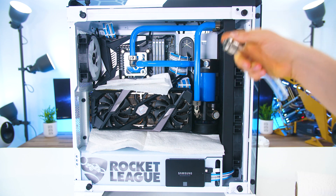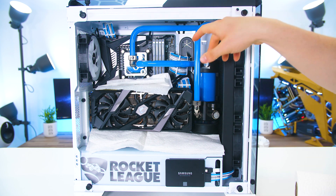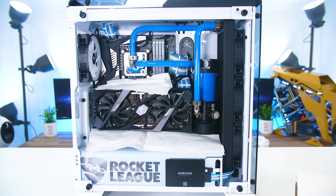By regularly, I mean at least once a year — do a coolant flush because you never know what's happening inside, especially with pastel colors. You could have stuff clogging the radiator or the CPU block. Over time, your liquid gains different ions and particles from the metals inside and actually becomes conductive again. Manufacturers grade their liquids at about three years per change, but once a year is my recommendation.